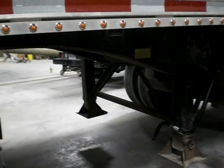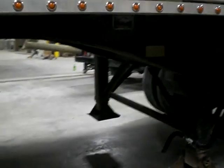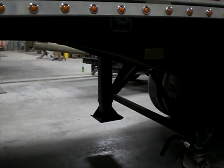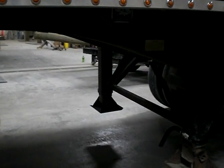But if I was to pull that out, I would have several gears. The first gear pushed all the way in, I would have 40 turns to 1 inch. If I pulled it out, it would be 4 turns to 1 inch.